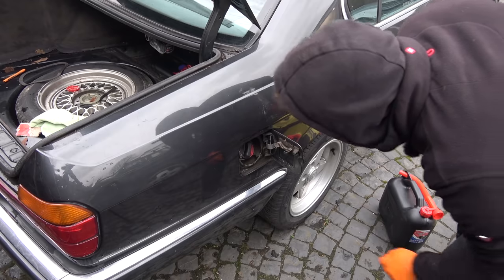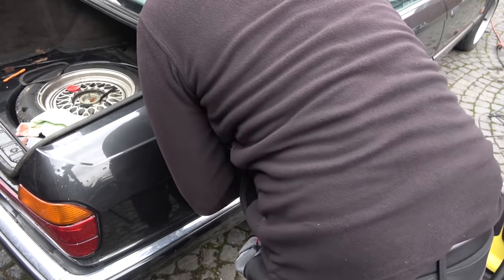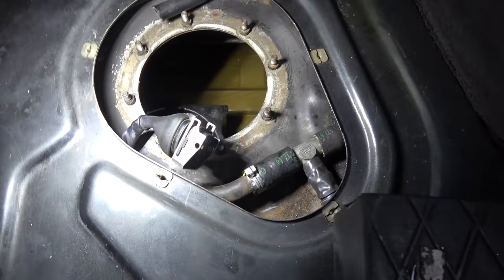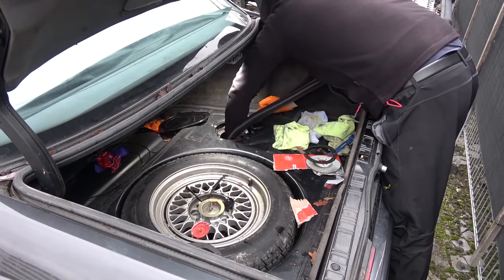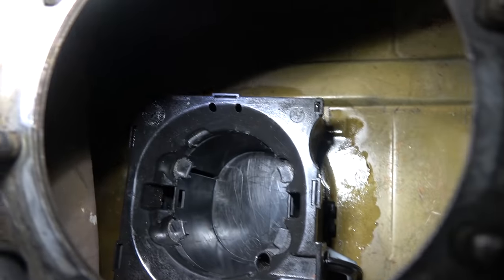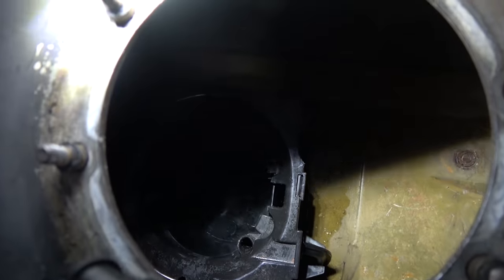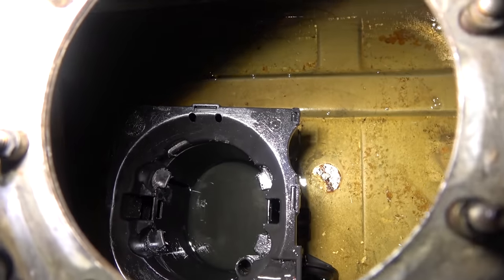I got fresh go-go juice — just a couple of liters in — and it doesn't look too bad. I'm going to clean it one more time with a sponge, collect all the garbage, vacuum it, and that's going to be it. I put fresh fuel in, sucked it all out again, sponge, microfiber towel, and final vacuuming — and that looks pretty good now. Even if there's something still on the bottom, that's what the strainer and fuel filter are for. The important thing is the fuel tank is not rusty, and there's nothing floating in there.